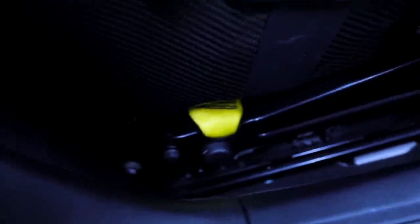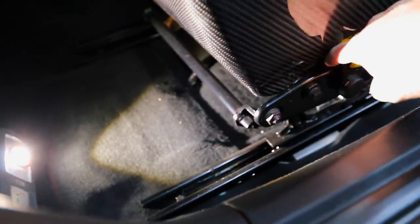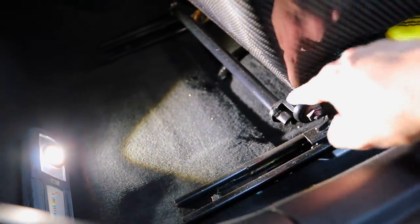You just tuck this down in there, and then this strap right here we're going to feed down in between here — it's going to come down behind the seat belt bolt. Feed it in down behind this bolt, and then there's a bar. I'll slide the seat forward and show you — there's a bar that we're going to fix some Velcro to, and that's where it's going to pull all this tight and make sure it stays taut. You put some Velcro right on here, zip tie the Velcro down so it doesn't come off, and then that strap is going to pull taut and you wrap it and secure it down.